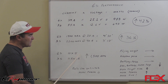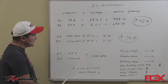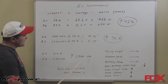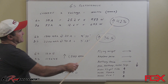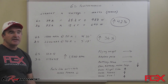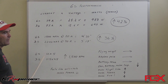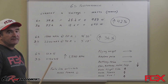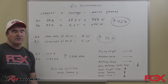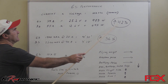You can see the prop size is quite a bit different, even though the 6S is still turning at 1500 RPM more. So this much more RPM, this much more power, and for a similar weight — because the plane weight is very similar, just a couple of ounces more, a very small number. So the power you feel at the end is significant — it feels like 60 or 70 percent more power when you consider the prop and the watts.